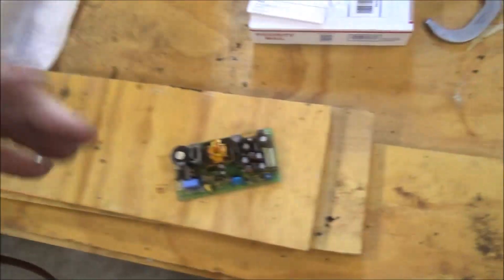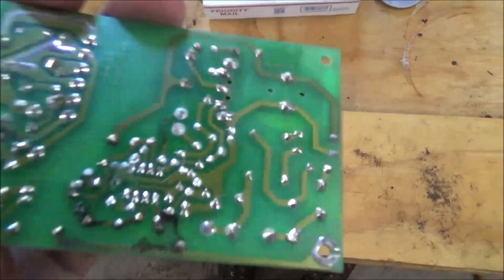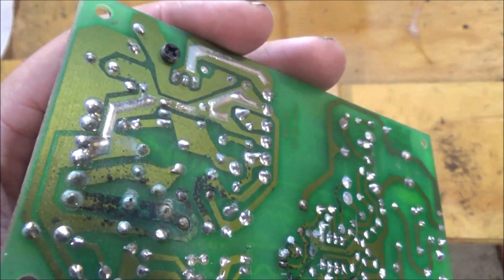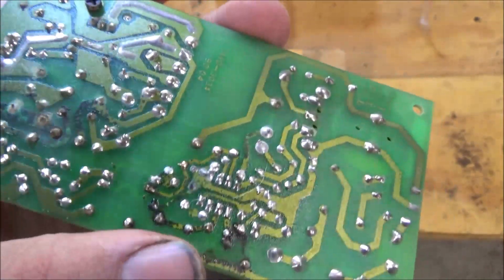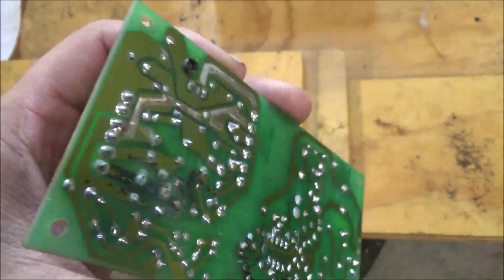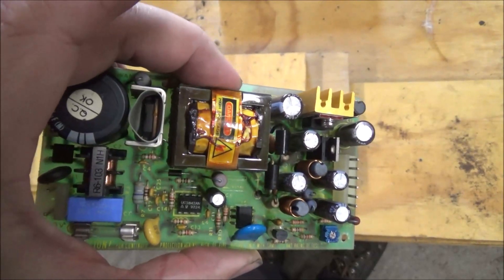He's down here today hanging out with me and I'm gonna try and fix up this digital readout for the last time. I had it unplugged for a while. When I plugged it back up, it wouldn't come on again. I'm pretty sure that the corrosion in these traces on the back of this board is gonna be the main problem. So rather than re-soldering all this and adding a bunch of jumper wires to fix all these traces, I think my time is better spent just putting a different board in here.